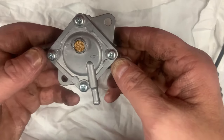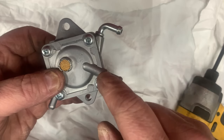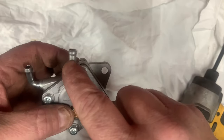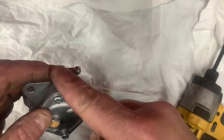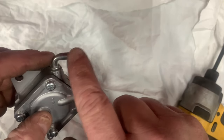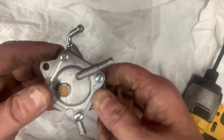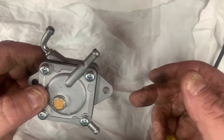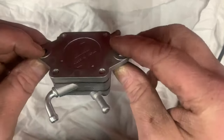A lot of people complain that they replaced the fuel pump and when they crank the engine the fuel pump isn't working — but it is. You could have an issue downstream from the inlet. Sometimes they put the fuel filter before the fuel pump, sometimes after — either way works. You need to check and make sure the gas line from here to the tank doesn't have any pinholes or leaks, because when you crank the engine these are self-priming. If you have to crank and crank and crank, you've got some issue downstream from the fuel pump, because it should not take a whole lot of cranking to get this thing primed up.